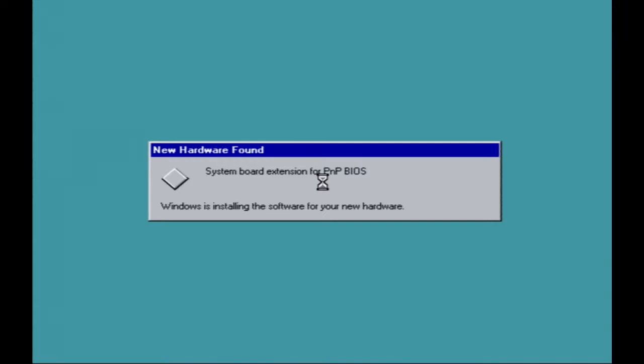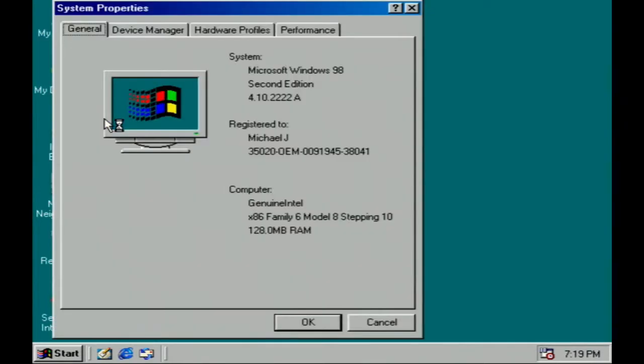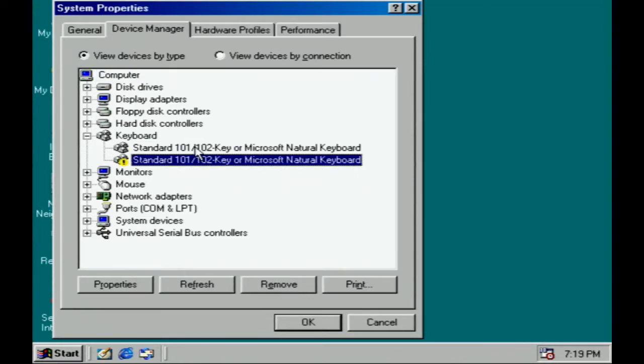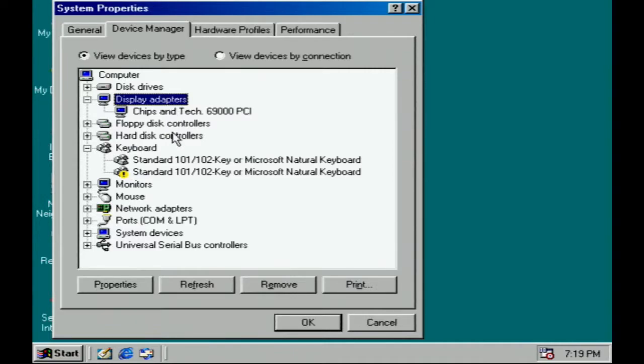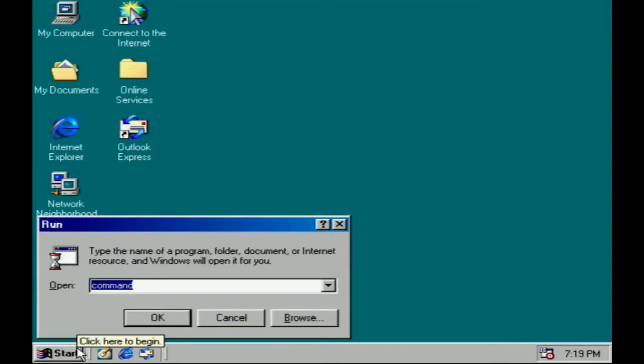After just detecting all the devices, I had a working Windows 98 PC basically. After a lot of hardware detecting it seems to have finished. I've got two entries for the keyboard — not sure entirely why. I was playing around with this earlier and found if I deleted one, it still tried to detect both, so I'll just leave it for now. The Chips and Technology VGA adapter seems okay — actually seems pretty snappy. The Windows keys seem to work.